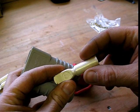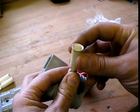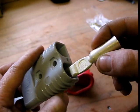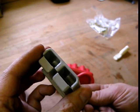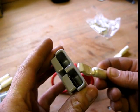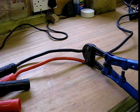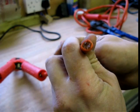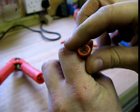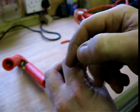The problem is, because they're quite specialist, they do need to be crimped properly, but I don't have a proper crimping tool, so the other alternative is to solder the terminals in. Once you've soldered the terminals on, you literally push them inside, and there's a special metal plate there — the top of the plug actually latches over the top of the metal plate and it's a nice solid connection. The nice thing about these jump leads is they're nice quality multi-strand cables, so they should solder a lot better than really thick nasty cables. It's worth spending a bit of money on decent cable because it's a lot more flexible, and the more strands, the better it transmits current.